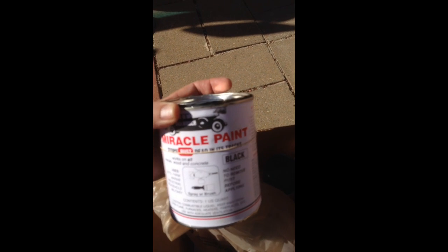The first thing I'm gonna do is grind all this down with just a wire wheel — not a grinding wheel. All we need to do is get the loose surface rust up, and I don't want to grind all the rust away because I'm gonna be using a product called Miracle Paint. I have two kinds: the thin version and the thick version, with different layers of fiberglass to create a new floorboard and patch these holes and then do the whole thing.